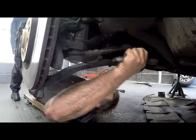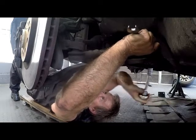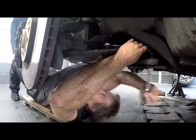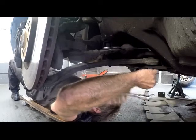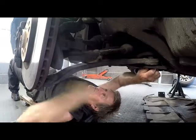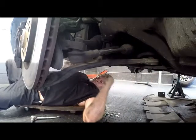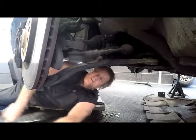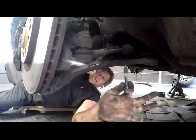We'll attach the spanner to the top to hold the top bolt or nut. It is actually a nut and bolt arrangement. We'll turn it out, getting the spanner to lock against the body. We'll turn this bolt out all the way. Now, that's your top nut. So we've taken out the front bolt, which goes in that way, and now we can pull this bolt out completely.